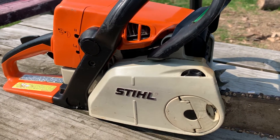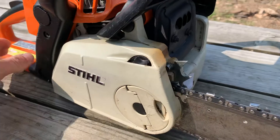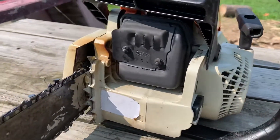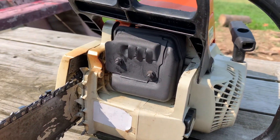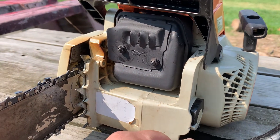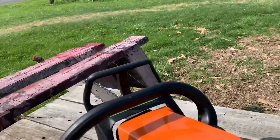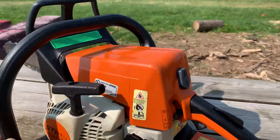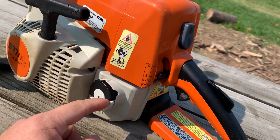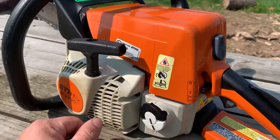I got it all together and boy, was this thing dirty. I don't think it had ever really been cleaned properly — there were wood chips, oil, just everything caked everywhere. This thing looks brand new compared to the way it was. The muffler was really nasty and rusty, so I took it off, cleaned it really good, and used some high-temperature paint like you'd use for wood stoves. I replaced the spark plug, air filter, fuel filter, and oil filter. All the other hoses and everything really seemed fine.